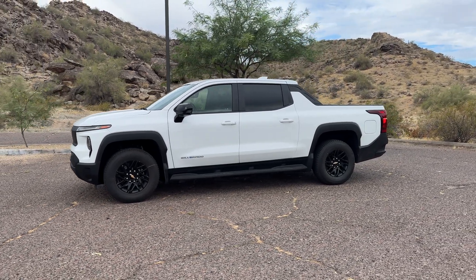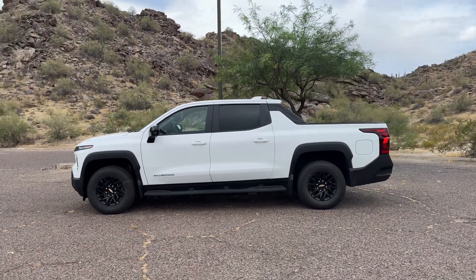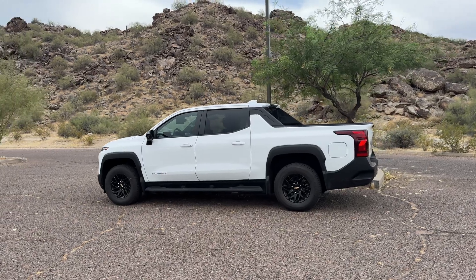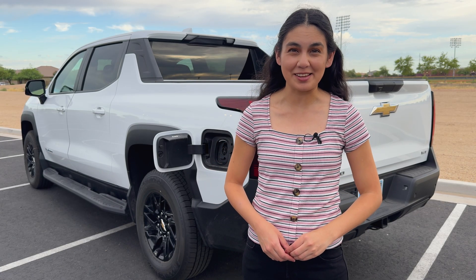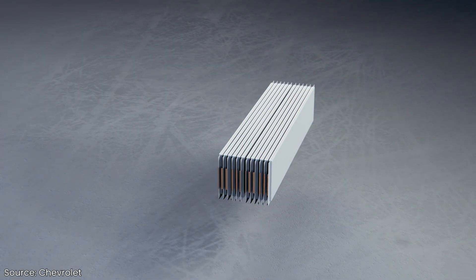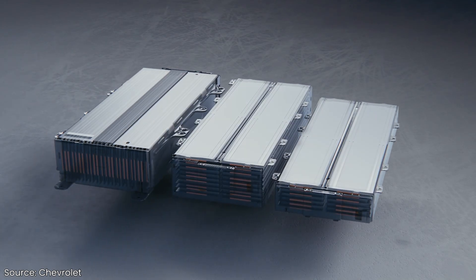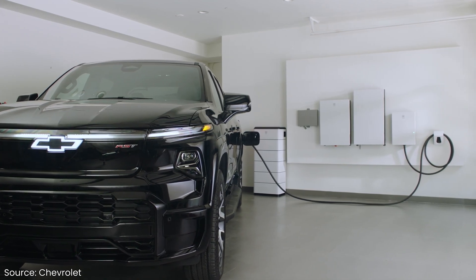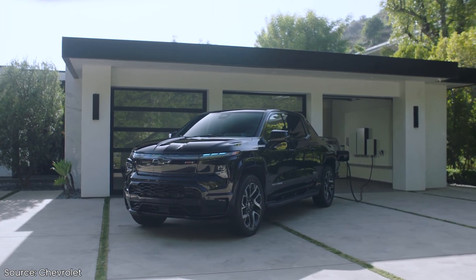Another cool thing is that it has a wireless BMS. In most cars, the battery management system has wires running all over the pack to monitor its status, leading to a lot of weight in the cables alone. Removing these makes the battery pack lighter, reducing cost and increasing efficiency. It's also modular, so GM can add or remove batteries to fit a particular vehicle — something like this Silverado would have far more modules than the rumored Ultium Bolt. GM also seems pretty committed to vehicle-to-home capabilities; all cars released so far using the Ultium platform are compatible with their V2H enablement kit.